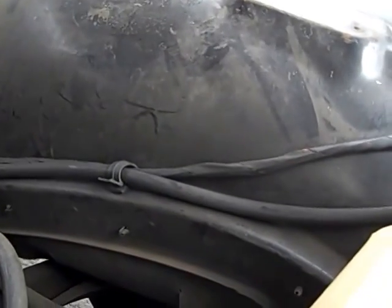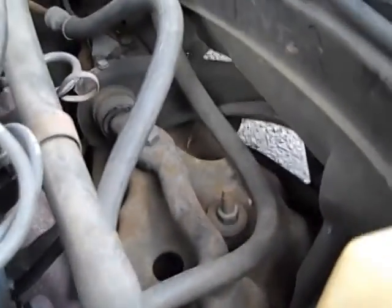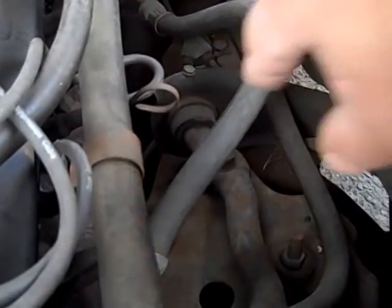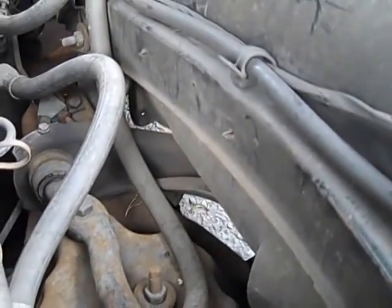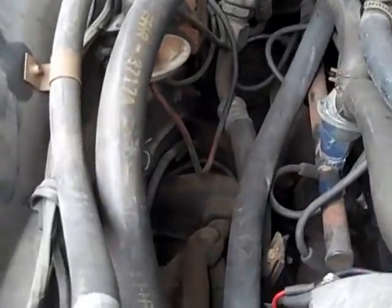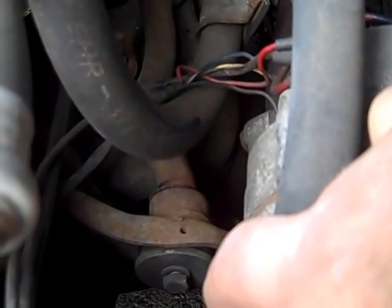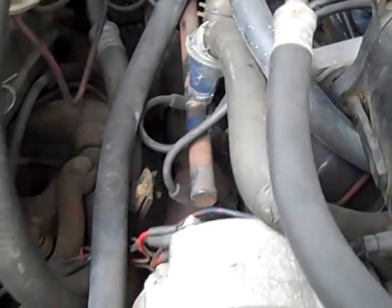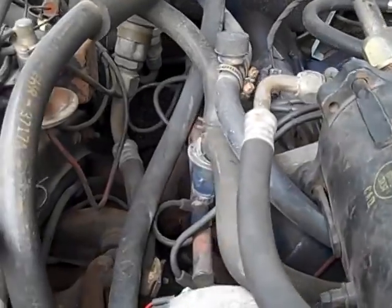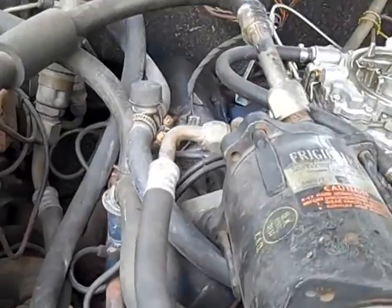Now what's going on with the lean on the left front wheel? These rubber bushings, control arm upper and lower, are rotted out, and probably the lower one is also. So looking at those, and the ones on this side, that one's definitely gone, and the nut's loose on the back washer there. So front end definitely has got to be gone through. Hoses, belts, all that. This is in the wrong place. Get things back where they're supposed to be.